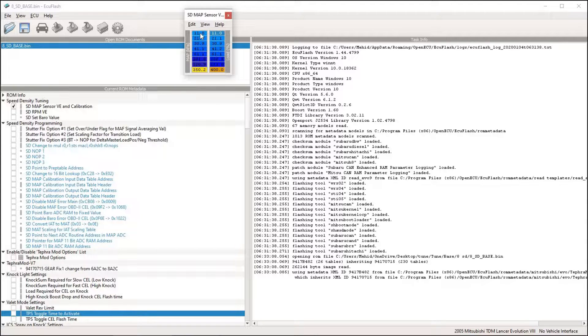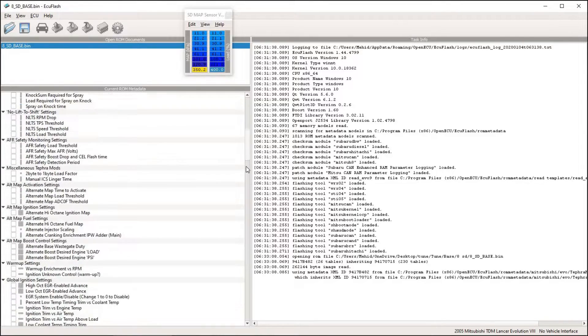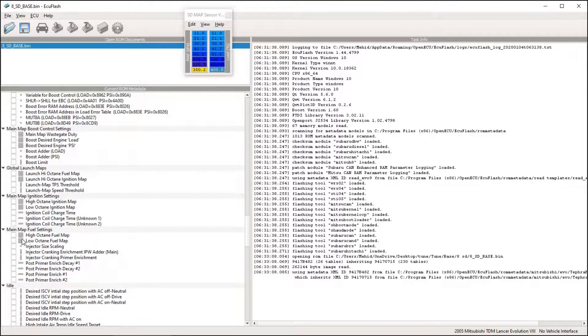To understand the 1-to-1 ratio: when the sensor sees, say, 30 kPa — around idle — it tells the ECU we're seeing 30 kPa. You can change this to read higher or lower if you want a leaner or richer idle, but I suggest leaving it 1-to-1. Then only change it up top when in boost — so at say 35 psi, you can tell the system to use 400 kPa in calculations. The reason you'd want to do that is for safety, and I'll show you what that means.